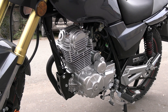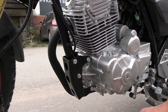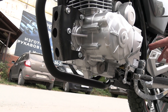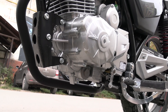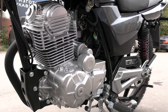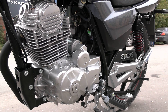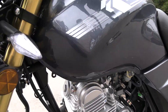As we can immediately see, the frame on this motorcycle is of an open type — not a closed loop. The engine itself serves as a structural load-bearing element, connecting the front part of the frame to the rear. During today's test ride, I did not feel the frame flexing at all — in principle, the frame holds the load well.